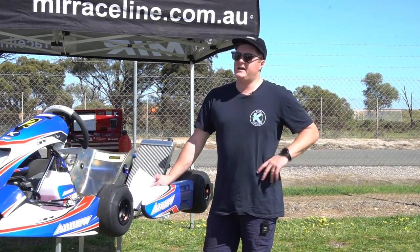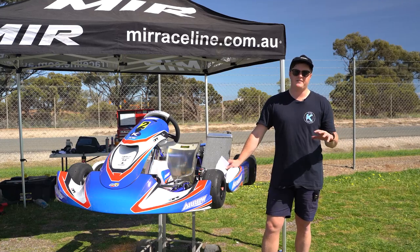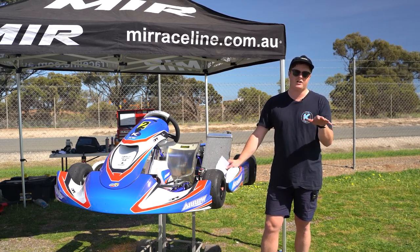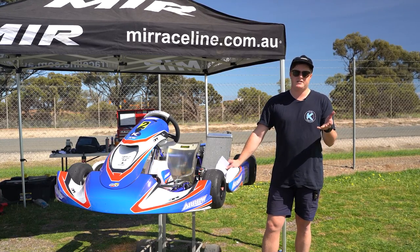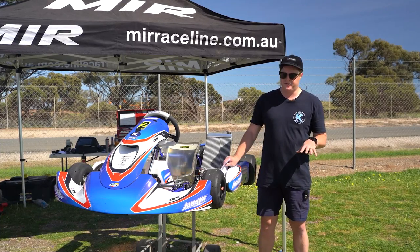In terms of tyre wear, we're at Bolivar Southern Go-Kart Club — it's been resurfaced. It is a billiard table, so the tyres look like they've done five laps. We start off at about 15 psi cold. If you go out at about 11, your tyres are going to slide around, get hot, and you won't be very fast. What we've learned is if you go out at about 15 psi, they only go up to about 16 or 17, but you get grip the whole time. That's one little trick at Bolivar on this brand new surface.